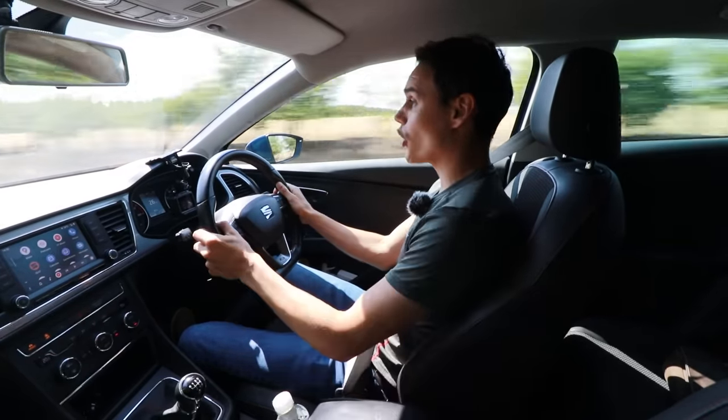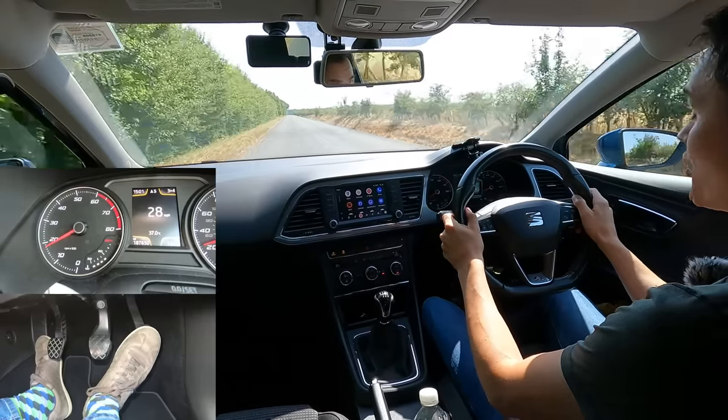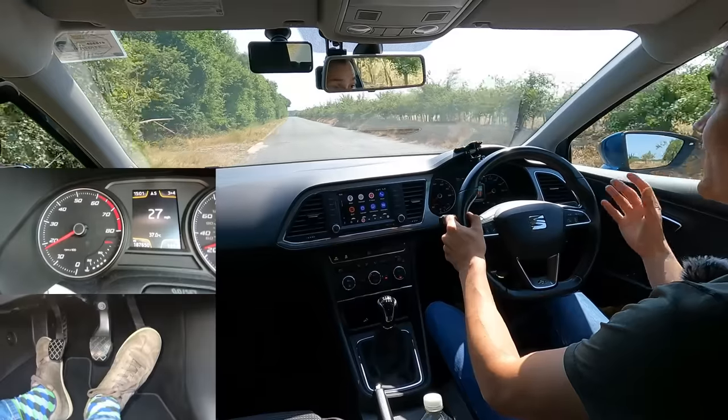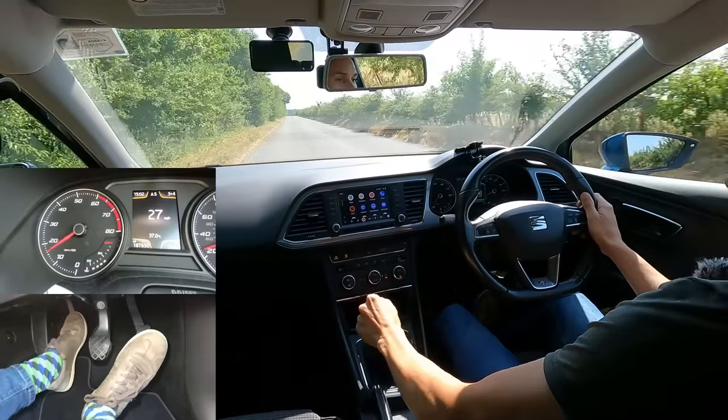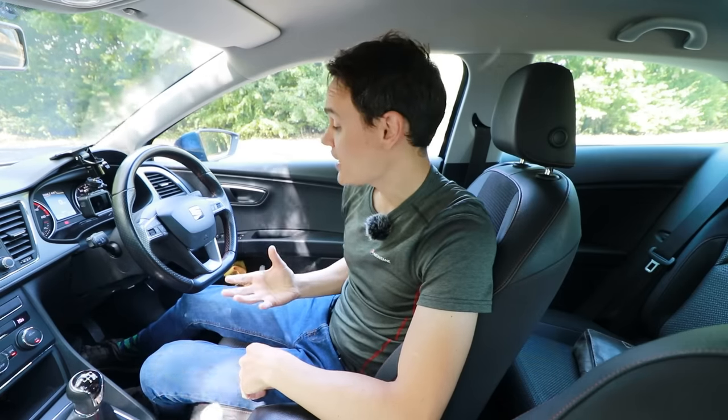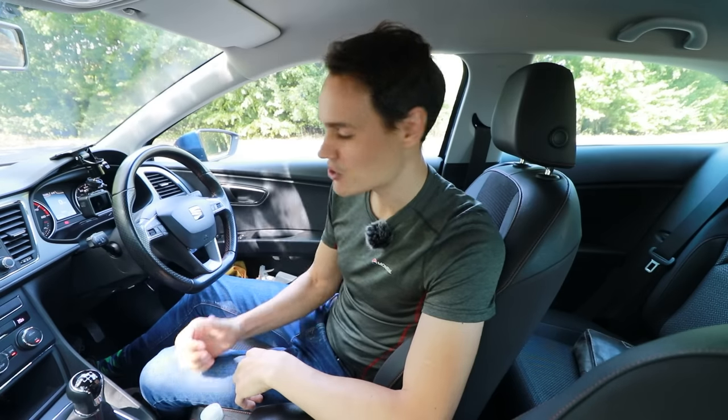This is handy if you want to go down a gear to prepare for an overtake. This method is similar to the previous one but instead of holding the gas gently, I'm going to blip the throttle to bring the revs up suddenly. Whether you hold the gas pedal gently or blip it suddenly is up to you - it depends what you find easier. I usually find it easier to give the pedal a good hard blip. The main disadvantage of using the gas pedal is that you can't brake whilst changing down the gear.